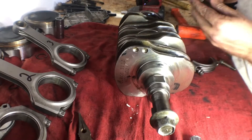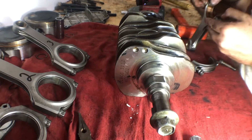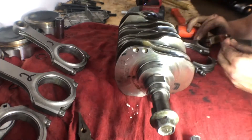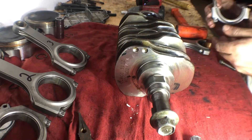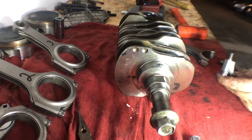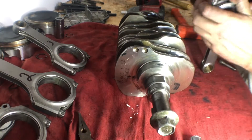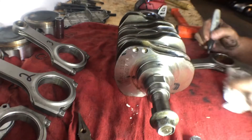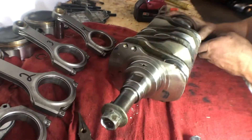Whoa — I don't think it's supposed to be brass. Something is definitely goofy here. This whole thing is worked. The other half of the bearing is stuck on there. I don't know if the crank is bad or just the bearing on the rod, but it looks warped just looking at it. Yeah, this rod is done — something happened here. Eagle logo on the side, number four. Should be good there. Crank is ready to be checked.